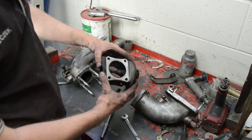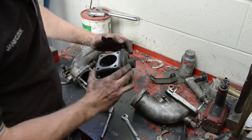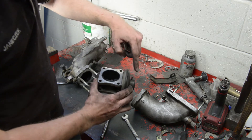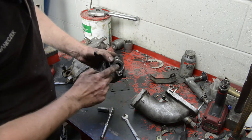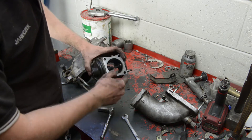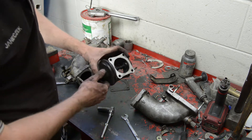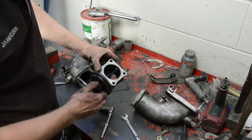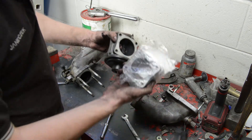And that is your EGR. What it does is vacuum or pressure gets pushed in here, which opens up this valve and lets exhaust gas back into the intake — and then all that crap goes back into your intake. So we're getting rid of that and installing this.